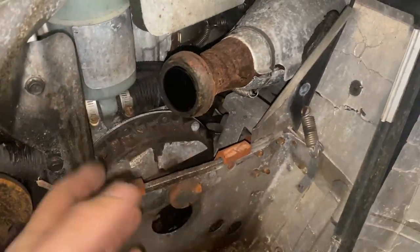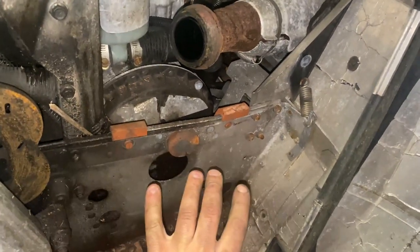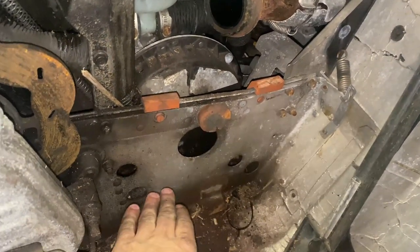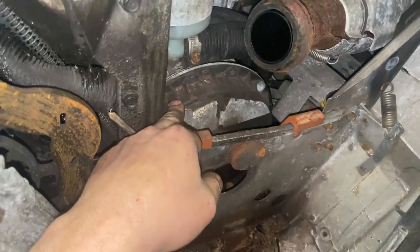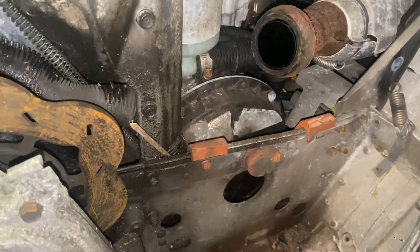I told you I'd show you a Gen 1 rev, so here it is. This is a very messy Gen 1 rev, but as you can see we have just kind of a full plate of steel here rather than just a straight up e-module — they call it now — just cast aluminum. Really it's all the same deal, you just got to kind of find your way through these holes. It's not any harder, just a little more difficult access and viewing wise. Alright guys, that's about all there is to mag side grease — pretty easy to do, definitely worth doing every 3,000 miles or every couple seasons. It's cheap enough. I'll post a link to the grease and some of the tools needed, and a link in the comments to the PTO side grease video. Thanks for watching, please like, subscribe, leave a comment — thanks, bye.